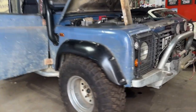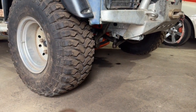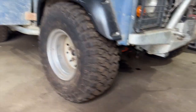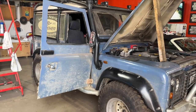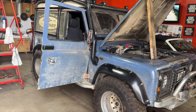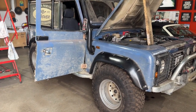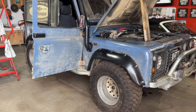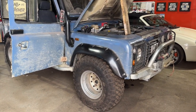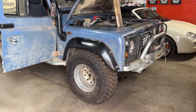We have got what looks like a fresh puddle under there — not the one at the back, but this one. So I need to check what that is. And the temp gauge was a little bit erratic. I think where I've taken it apart I might have damaged something. So I've got another set of clocks out to try, and that worked. So we might have to just rejig another set of clocks, even though the mileage is out. Or we could take out the actual dial and swap it over — I'll have a look in a minute.